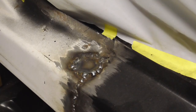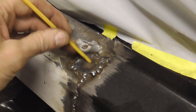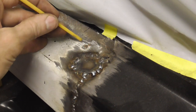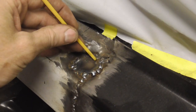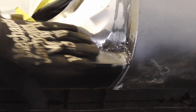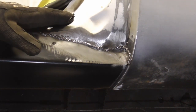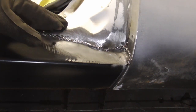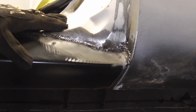Lastly I just want to show you a pitfall that I did run into — I ran into some thin metal right here, a little bit rusty, that I had to cut out and put a patch. I probably should have cut it way back here but I didn't know. Sometimes you run into pitfalls that you just have to fix. These welds can be ground down, sandblasted, knocked down a bit, and filled. I hope you enjoyed this video on butt welding patch panels and some of the pitfalls you might run into. If you did and you'd like to get my latest videos, don't forget to hit the subscribe button.